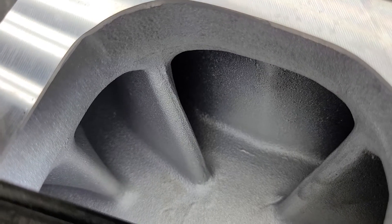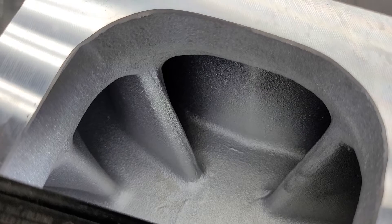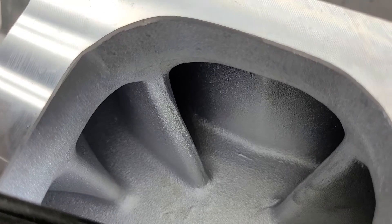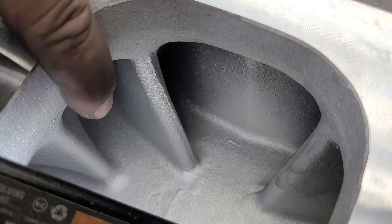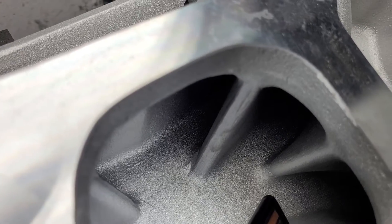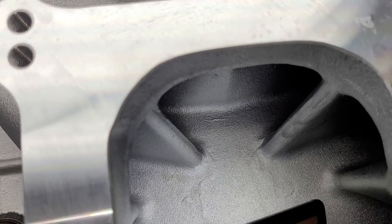What I'll probably do is a rough out, because it doesn't make any difference what it flows stock - it's a mess, it's a mess stock. I'm not even wasting time putting it on the bench completely stock, it's a disaster. These are not even radiused, they're relatively straight. It needs a bunch of work, and since it's only flowing 220 it needs a lot of help.